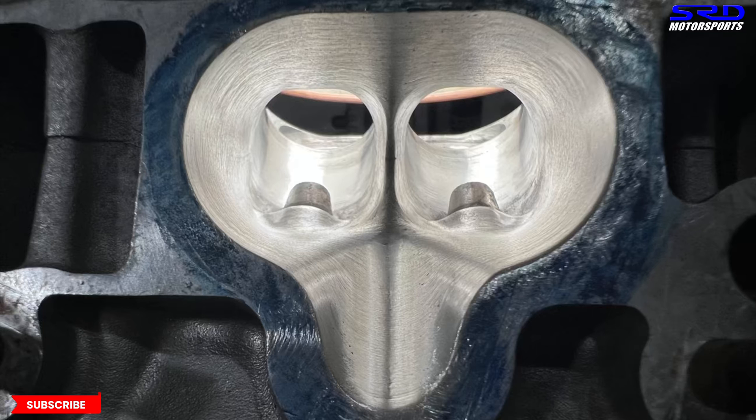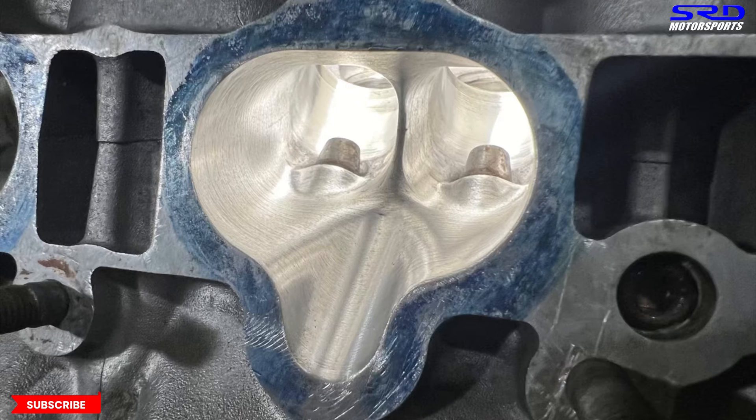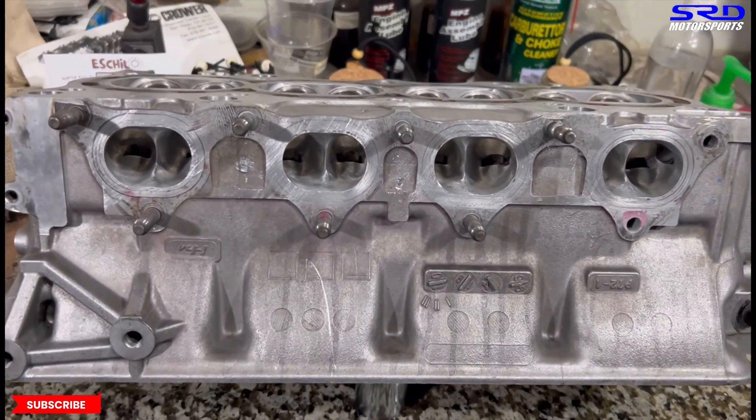Here's a picture of the port itself. The short turn above is a bit wider, which is helping flow turn. You can see the port finish has gotten really really good — that's from the lubricant mix we use. It's all good. Now onto the exhaust.